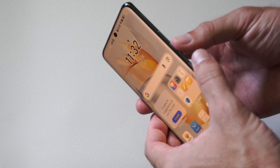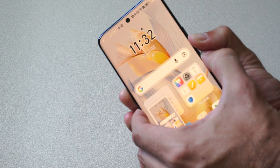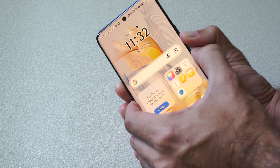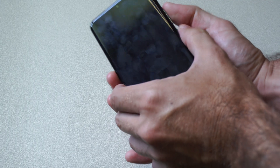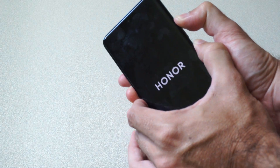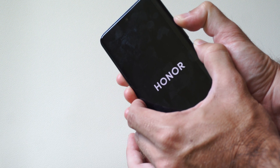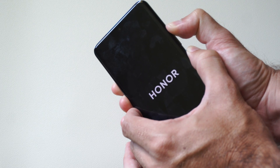So let's do that now — power button, volume down. This will initiate a forced restart and it will take a picture as well, so you're going to have to delete that later on. Just continue to hold this down and your phone is going to turn off. Switch now to the volume up and the power button and you're going to see the brand of the phone. Continue to hold those two buttons down until that goes away and then let go.